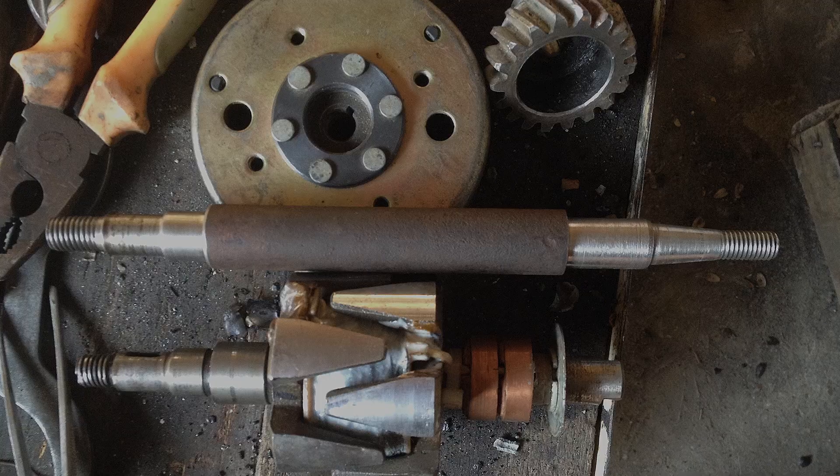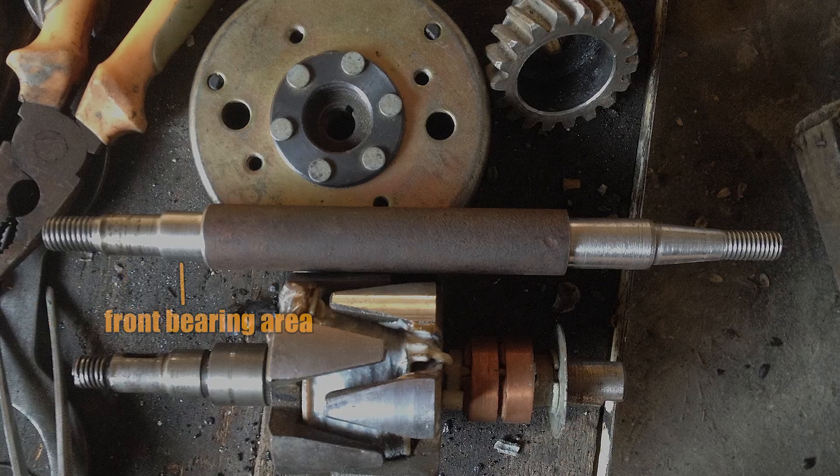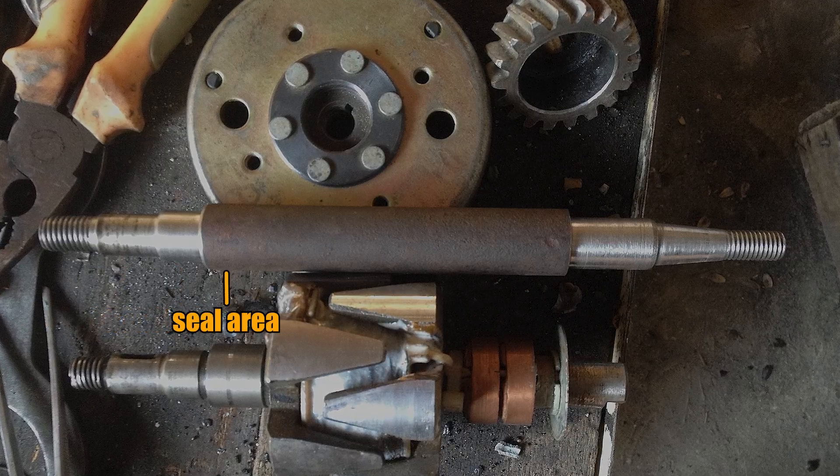Initially I wanted to keep the Dnipper generator too — 150 watts of the Dnipper generator and 150 watts of the scooter generator would ultimately produce 300 watts. But then I realized that 150 watts of the Dnipper generator has always been enough for me. I'm not a fan of a bunch of lights and a CD changer on a motorcycle. So if I throw away the Dnipper rotor and only have a scooter generator left, its 150 watts will be enough. Long story short, I went to a turner and he machined the shaft of the scooter generator which fits into the empty Dnipper generator housing.